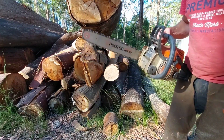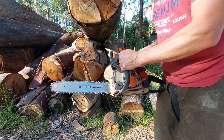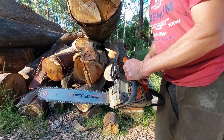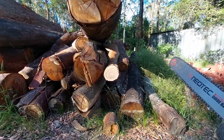This thing needs time. The rings aren't bedded in even before, but there's no squish. The compression's really low. It's not, unless it comes better, but I don't think I'll ever make this thing a powerful saw, but I'll run a bit more and see how it goes, and I'll make a video if it does come to life.